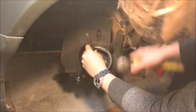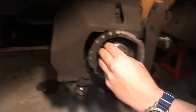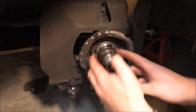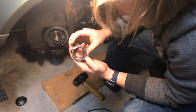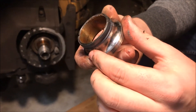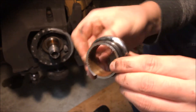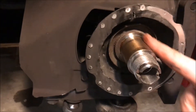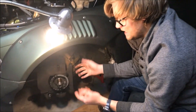All right, so we've just cut some more — and we cracked it off. Now we've got a slit, and you can just pull this puppy off, maybe with the help of a tool. So what we have here is it's cut mostly through, and when you smack it, it cracks it and allows it to be removed. There's a hairline crack through here — it just fractures it and allows for its removal. As you can see, no marks — the spindle is perfectly fine and ready for reinstallation. That's how you do it. The rest is cake, you'll be on the road in no time.